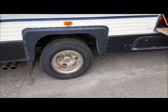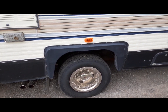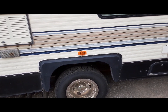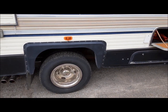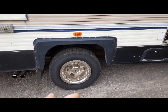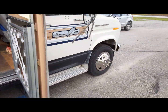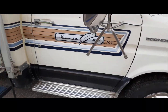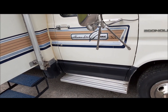The only other preparation I will do is before it actually goes on the road, I'll just go around and grab everything. It's like a circle check you do on a truck. Make sure nothing's hanging off, make sure the mirrors are tight. I'll check all the tire pressures, give the hubcaps a bang, make sure they're on tight. I'll crawl underneath it on my creeper. There's lots of room under this. I can roll around on the creeper, make sure everything looks good under there.